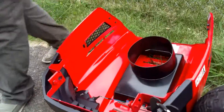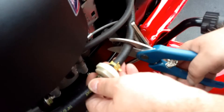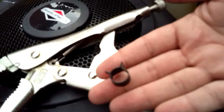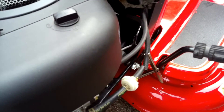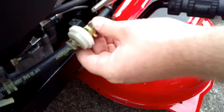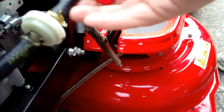Now we don't have to worry about that being in our way. We just need to cut this hose here between the vise grips that have it clamped off. There are some little clamps — you just compress those clamps. You can't do it with your fingers; you'll have to use vise grips or a pair of pliers. When they're pushed down then you just put them over the hose. Now you can put the cutoff valve on — it just pushes back in the hose. Bring that clamp up and twist it a little, and the clamp's caught.